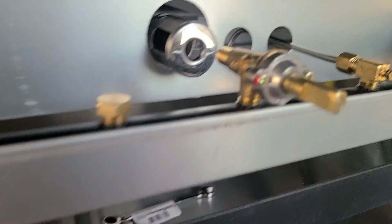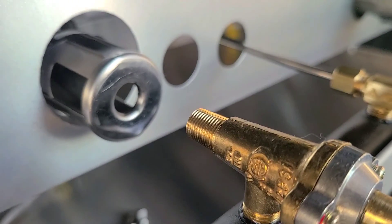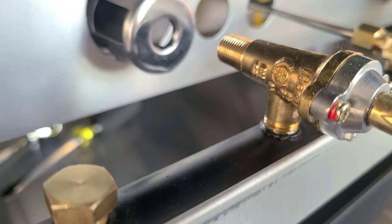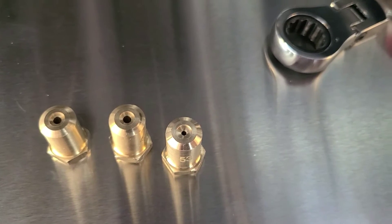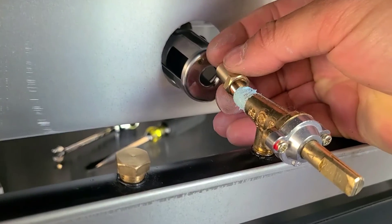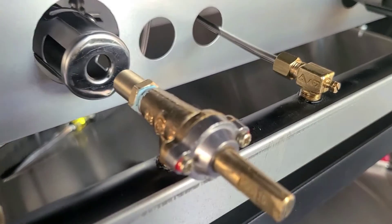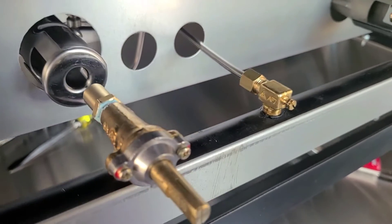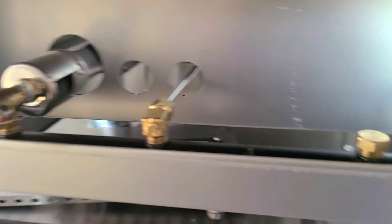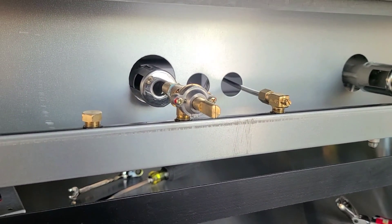I tried the blue monster thread tape but I prefer the pipe thread sealant. You put just a thin layer at the edge of the threads. These are the old natural gas orifices on the left — you can see the opening is a lot larger than the new LP orifice on the right that comes in the conversion kit. You twist the new LP orifice on, and that's the final product. Then you reposition the screws back into place on the front and back, and that's how you convert from natural gas to LP.